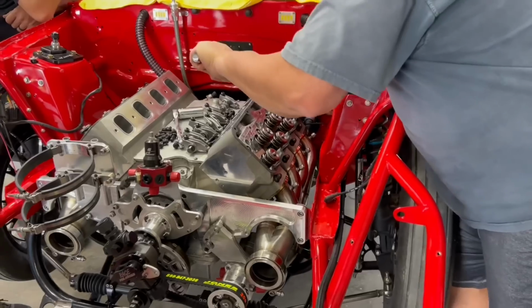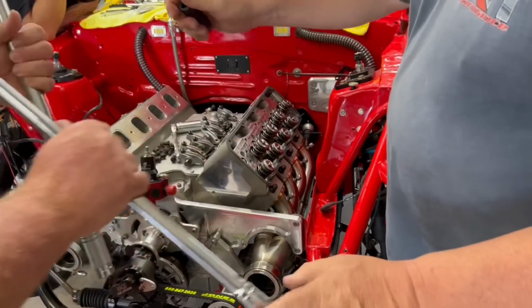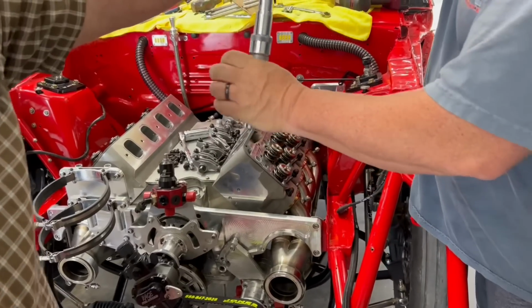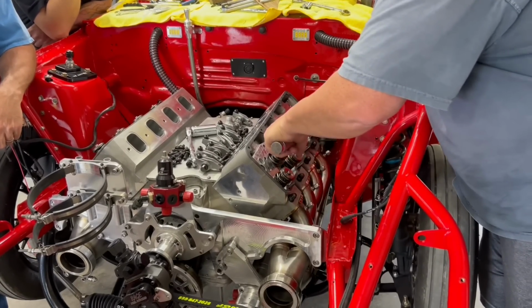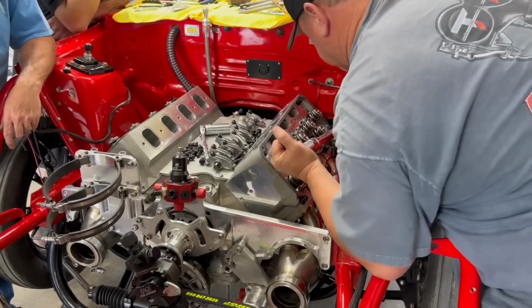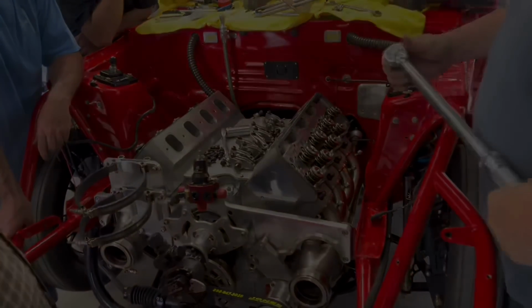And we just pull it. All you do is loosen it down to 75, 80 foot-pounds of torque. Some people might go less than that, but that's all we do. And you tighten it back up, easy enough. And this is the hard side because, you know, left-handed, you got to push and pull. So he's only got 2 more over here, and then we'll hop on the other side.